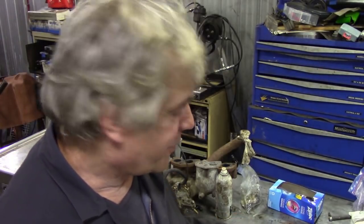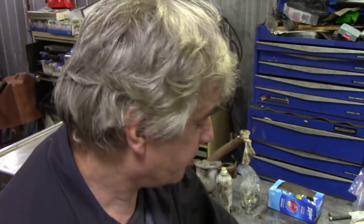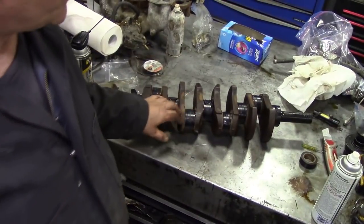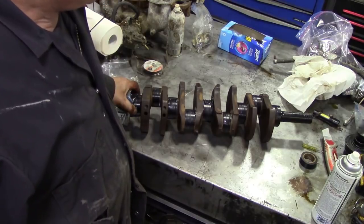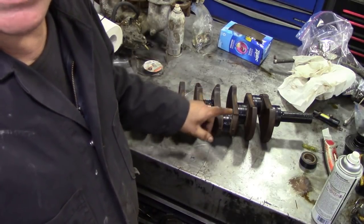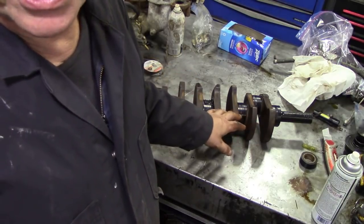Back to pushing the boundaries of Land Rover restorations. I'm going to do something that's going to make you comment like crazy — I'm going to sandblast a crankshaft. That's right. The 2.25 crank was pretty rusty and I don't like rust. But I can't find anybody who will dip it in acid, and I haven't got a bath big enough to acid-dip it myself. So this is what I've done: I've wrapped all the journals in electrical tape, then put a bag over the end so all the orifices for the drillings are all blocked off. This has been washed in a solvent so the tape sticks well.